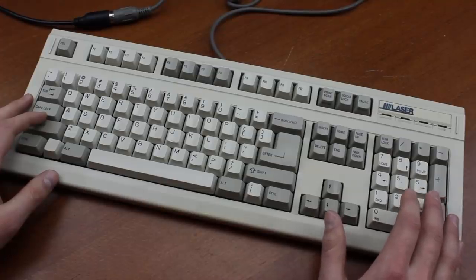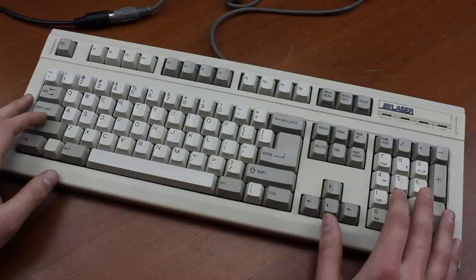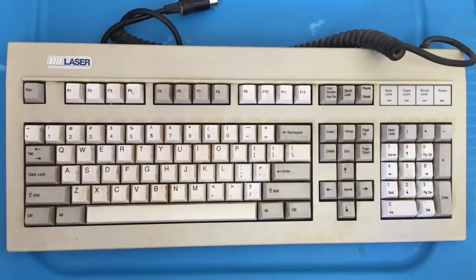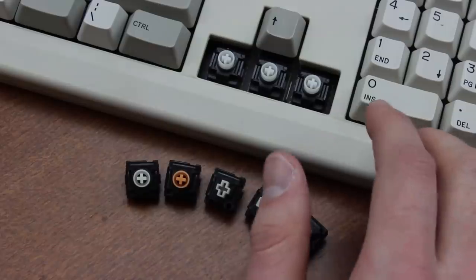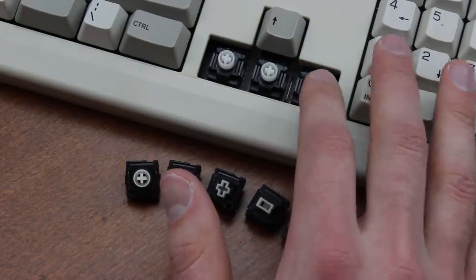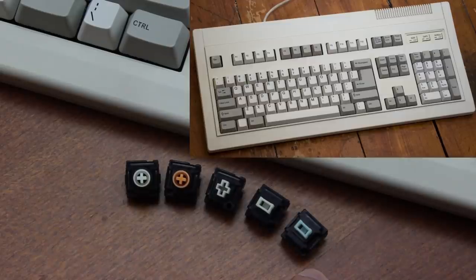It's one of two well-known Laser keyboard models. This is the keyboard that people generally go to when they want to try clicky SMKs, and the other one is the one they try out and find comes with dome with slider switches instead, which are worse — although I think that version could also come with SMKs. More specifically, the switches are SMK second generation of the clicky type, which I've previously shown keyboards of that use the Alps mount version with a blue slider, widely known in the community as the Monterey switch, because it was first reported in a Monterey K104.